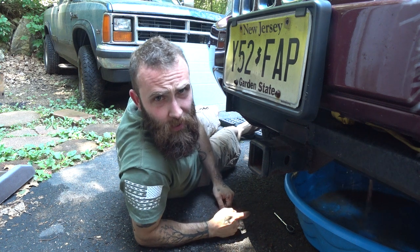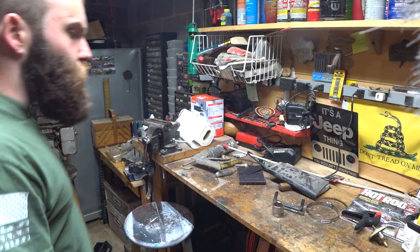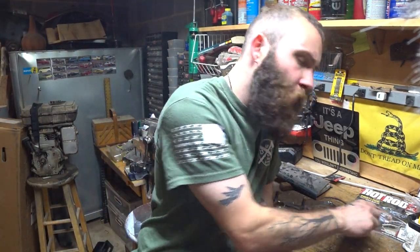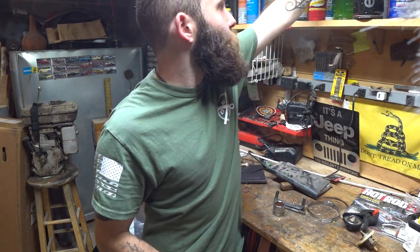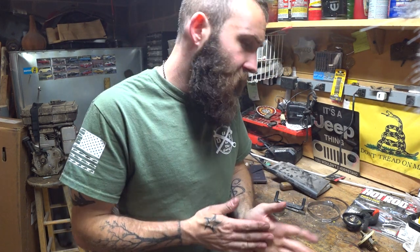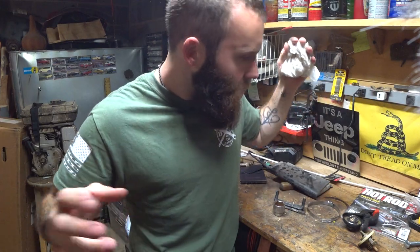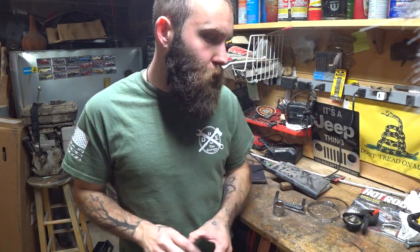And today we're talking about the 4.7 cooling system once again. Oh, Jiminy Christmas, I tell you what, Buck. All right, so I had to drain my coolant when I got that thing. The previous owner had put the lime-flavored coolant in. And as you know, the 4.7 liter and the 3.7 liter that went in Jeeps, Dodges, and Chryslers require the orange flavored. So I got all that stuff that'll eat away your aluminum heads out. I put the orange stuff in.